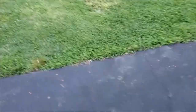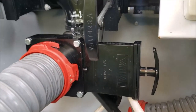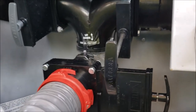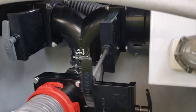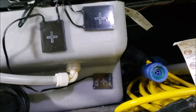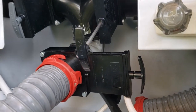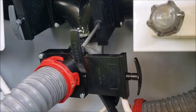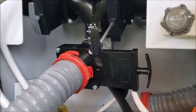It just went off — it took 5 minutes. I think it's quicker than the jet; it seems to be. I'm going to fill this up just one more time and call it a night. I do like this idea — it gives me a plan B. In case anything happened to the sani flush jet and it plugs up, remember that jet is really just cleaning the back side of those sensors anyway. This gives you a second option for getting fresh water into the black and gray tanks quickly. I think this is about the fourth fill and drain I've done, so I'll do one more and button it up.